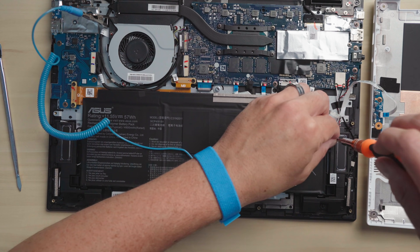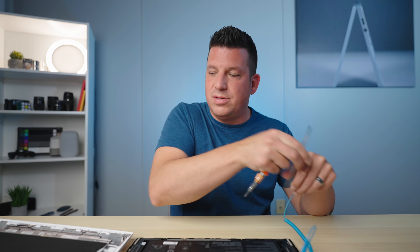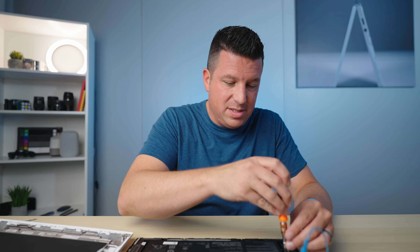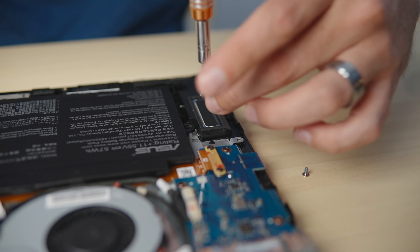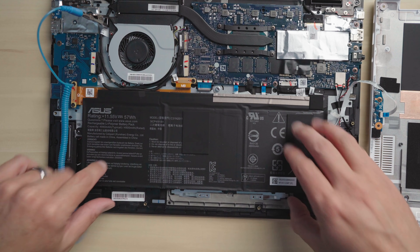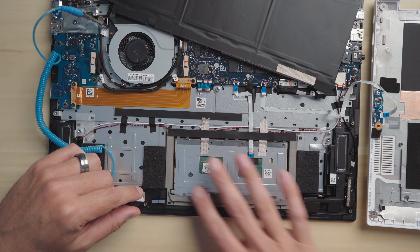What you're going to need to do is take off the battery. Keep your screws from different parts of the Chromebook in separate little piles — I think these are the same as the chassis screws, but you'll want to know where things go to put them back when you're done. We're going to flip the battery over carefully, since it is also connected, and now we can see the trackpad array.